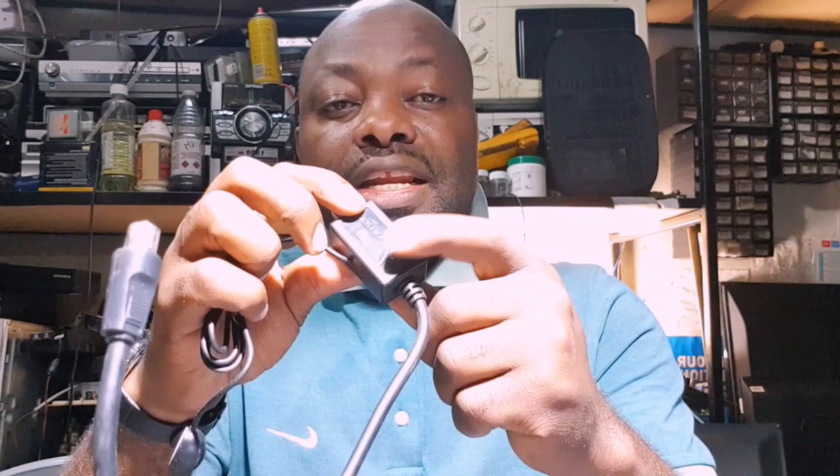You can see the male part there. If this light is not on, your remote will not communicate with the sensor. When you plug your TV link, make sure you activate the link on the RF settings. Depending on your decoder - PVR, Explorer, S-model, or HD DSTV decoder - you have to activate RF power on, or activate the TV link option. This light must come on to power the TV link so your remote can communicate with the sensor.